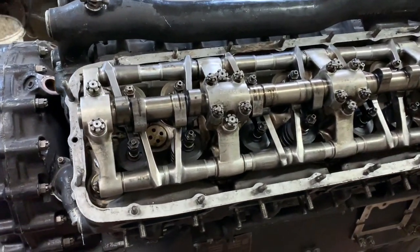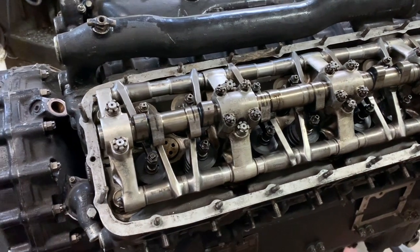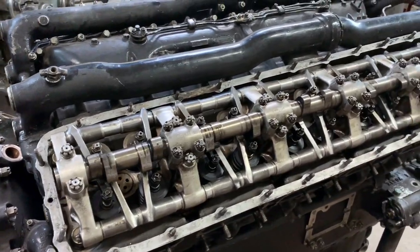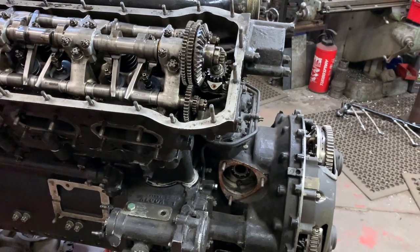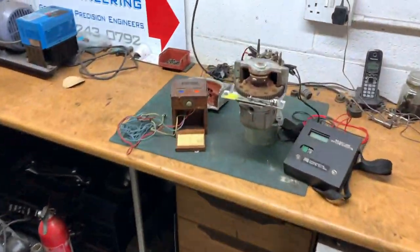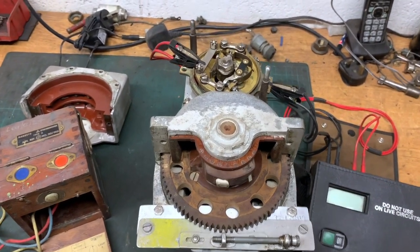I've now set the B bank valve timing. Because the valve timing is set on the induction stroke, being a four-stroke, the crankshaft makes two revolutions for every cycle of the engine. The first plug to fire — because they're actually timed seven degrees apart — there are two plugs per cylinder on this engine. The first is the exhaust firing magneto, which is going to go here, so I have to prepare the mag in the correct position. I've removed the distributor so I can see the rotor arm, and it's set in the correct position now — points are still closed.